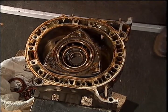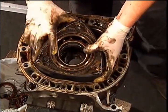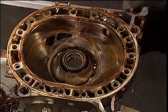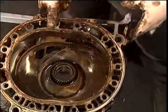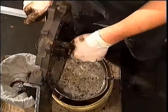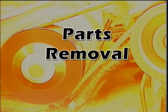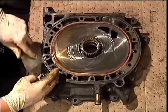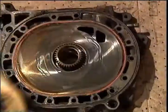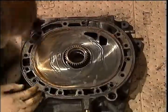Now take the front rotor out and collect all of your small pieces that may have stuck inside or fallen off the rotor. Tap the front rotor housing to remove it. And then take out the front gear. Remove the outer and inner water jacket seals with your tools. Small screwdrivers work real well. Take out the oil pressure regulator, pop out the rear main gear, and remove its old O-ring, because you're going to replace that when you rebuild the engine.